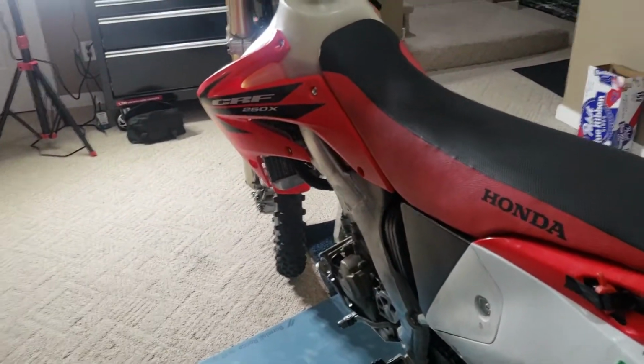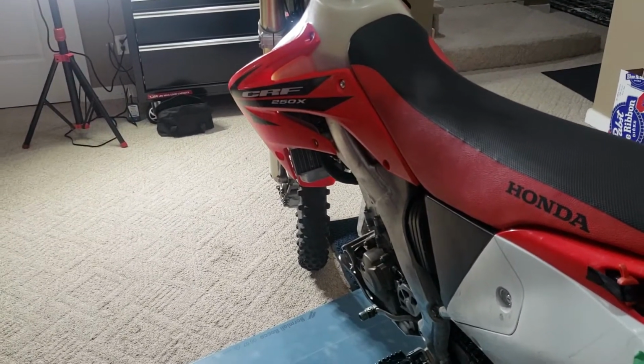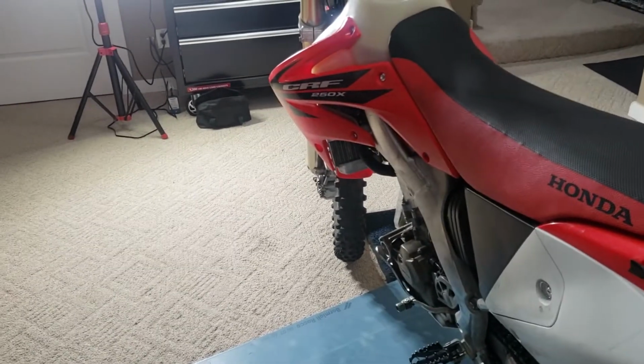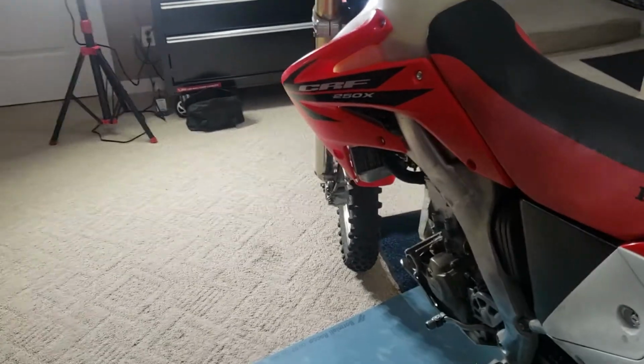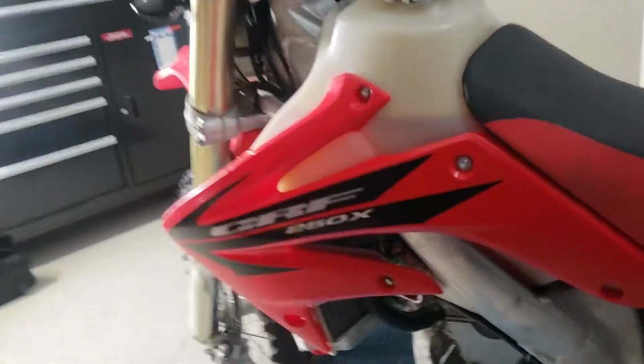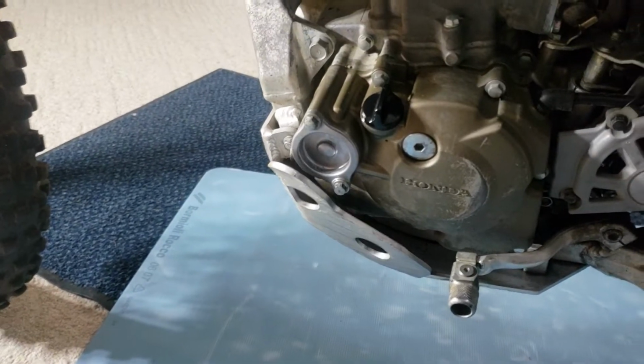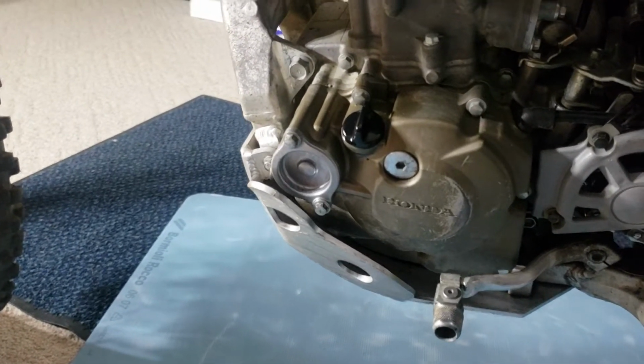over the place. Okay, well, first of all, before you drain your oil, start it up for a couple minutes. Get everything warm. Helps the oil drain out completely. Yeah, so drain your oil. Then you are going to pull off that cap. That's the oil filter in there.